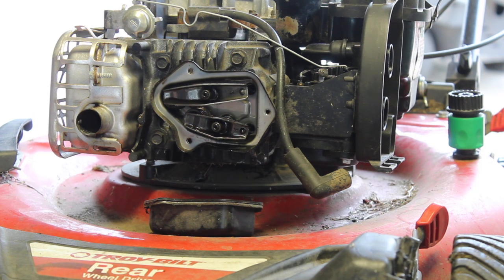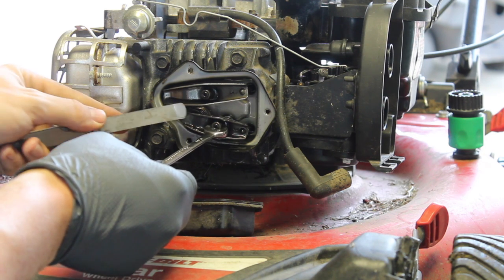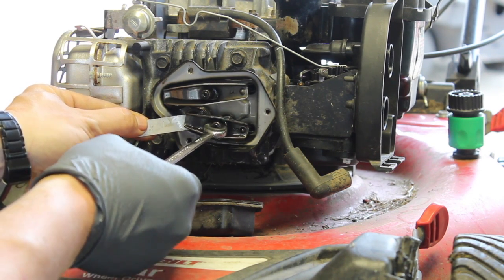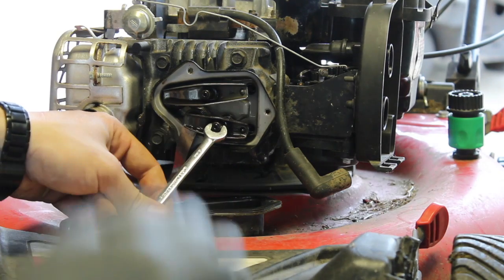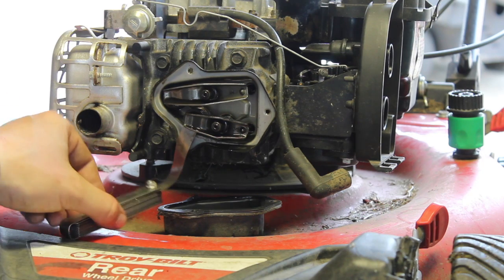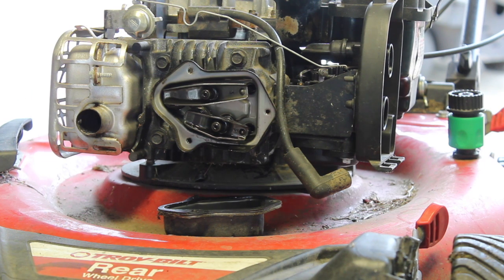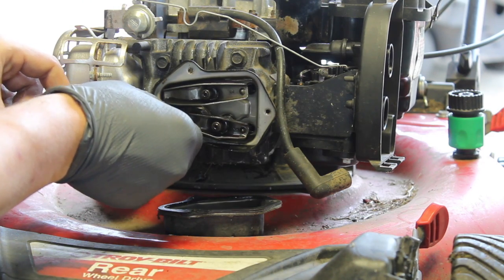Okay, for whatever reason, the guy's turned off, but, so, 8mm, T10 on the inside. You undo the T10 and then you kind of tune it with the 8mm. Then you tighten it. Right now you want it to be just snug. Maybe a little less snug. The hard part with this style is that you kind of have to hold it very still, tighten the T10 so it doesn't move. That's why you want to have the 8mm be a wrench, because if it's a socket, you'll just move the inner screw along with it, and you'll be sitting here for days just wondering why this isn't working.